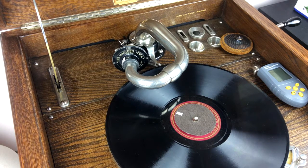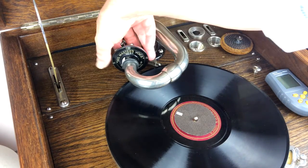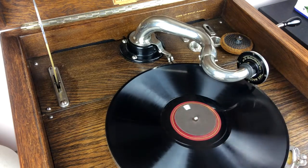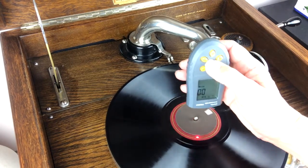The first set of tests I'm going to carry out are on my HMV 163 — bear in mind this has a number 32 motor, a really powerful motor. I'm going to do three tests: test the speed with the turntable under load by playing a record, then a similar test without the record under load, and finally a test without the turntable in place. I've got a disc in the center with light reflective tape from which I'll take a reading.